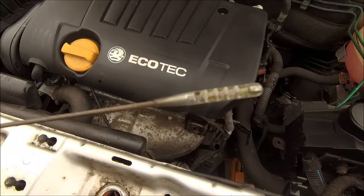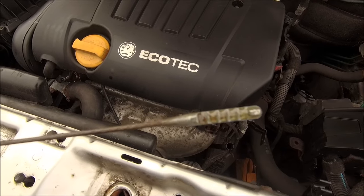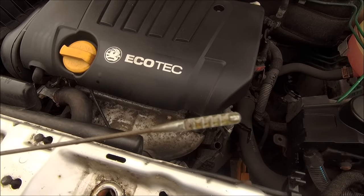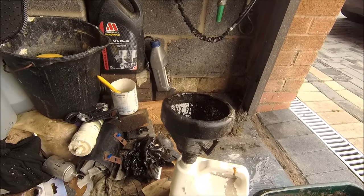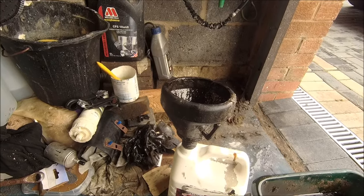Check for leaks and see where the oil level sits. We are up to the top mark now - that's after it's been started, run for 30 seconds, and then sat for five minutes draining the oil back. Oil is changed, simple as. And you know the score - oil gets put away responsibly into a tub, taken down the recycling centre.